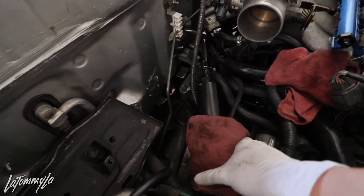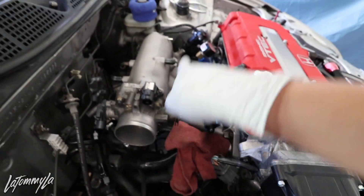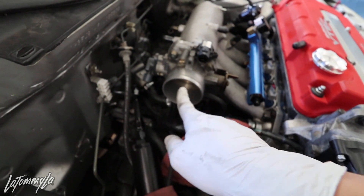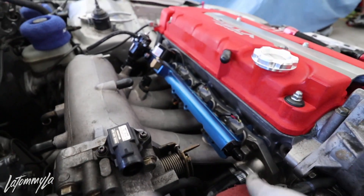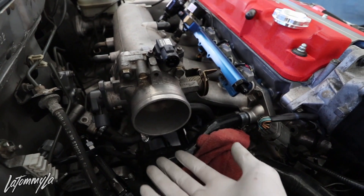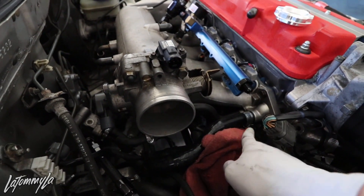One of the main benefits of having your own lines made is you can move the filter out of the way without harming the line. Then I gotta take off my fuel return line and this hose — I think this is the heater hose. The idle air control valve I left right here because it doesn't come out with the throttle body, and I won't be needing it anymore on the ITBs. I'm gonna take this hose out, let some coolant drain, and take off that manifold. Normally on Honda motors there's a bracket from the bottom of the manifold to the block, but my motor doesn't have it — makes it easier to access everything underneath.